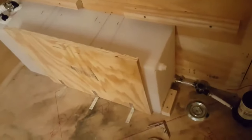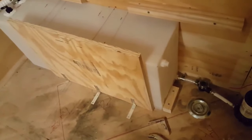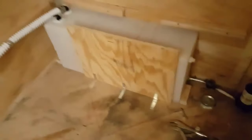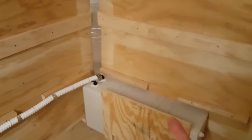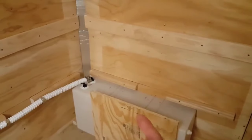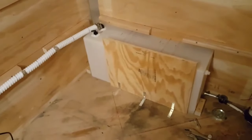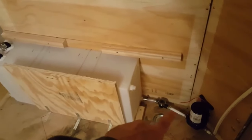Other things to consider when building one of these trailers is tongue weight and weight distribution. You don't want all the weight on the front or all in the back. I carry four 60-pound batteries over the axle as much as I can because I didn't want 240 pounds affecting the tongue weight. We also carry our water tank in the V-nose, and that's why we keep it pretty much empty — it would be an extra 200 pounds on the nose.